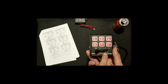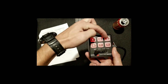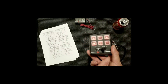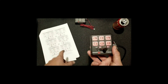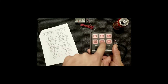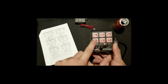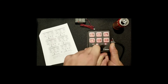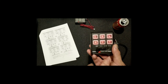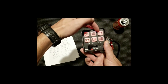So to get to any point-variant keypad — whether it's 1.1, 2.1, 4.1, or 6.1 — you hold all three top buttons at the same time, move your slide switch to position one or two, then push whichever button you want, and that gets you to that keypad function. Slide switch all the way to the left gives you standard keypads 1 through 6. Slide switch in position one gives 1.1, 2.1, 3.1, 4.1, 5.1, 6.1. Slide switch in position two gives 1.2, 2.2, 3.2, etc.